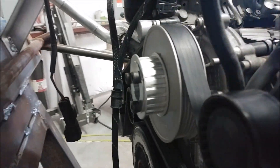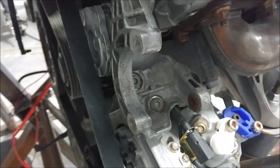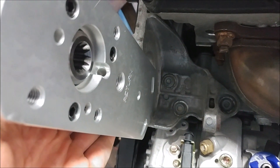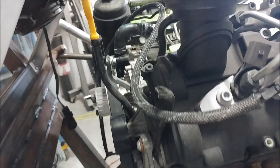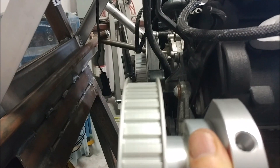The guys over at Preferred drilled the three holes in that small pulley for me, so I've got that mounted now to the water pump pulley. The next process is to align the governor controller adapter plate. You can see it's mocked into place where it's going to be — sitting up against what is normally the power steering pump mount on the engine. It lines up nicely with that pulley there, and we might have to shim it just a little bit, but basically it's going to work where it is.